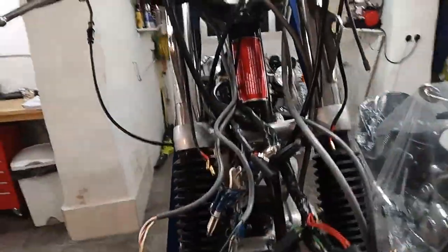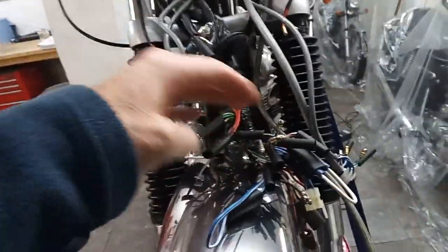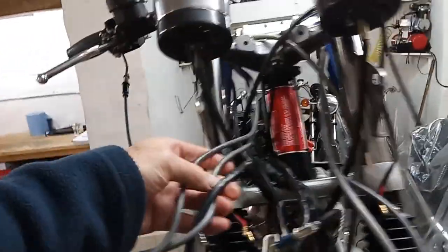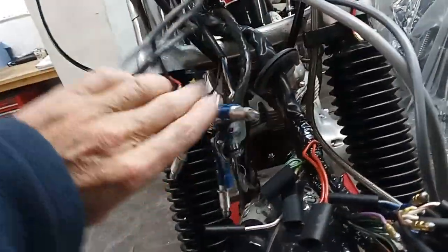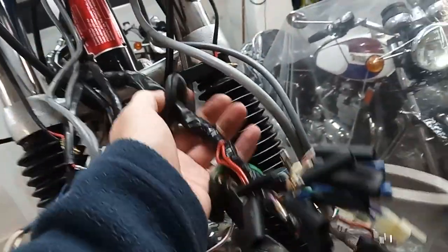Starting to replace the old rusty headlamp. I've had to take the spaghetti wiring out. The only advantage I've got is that it was all connected before, so I've taken loads of photos of how the wiring was connected. Basically we've got three lots of wires that go through the left-hand grommet hole, then three lots of wires on the other side. That's for the ignition so ignore that - it won't go in the headlamp. Then you've got the main spaghetti - the main loom - which goes through the central hole.